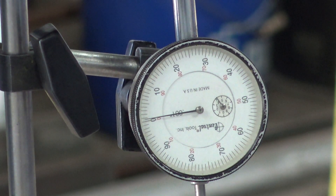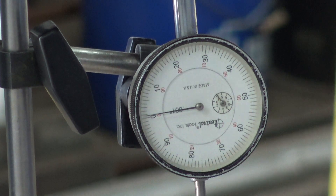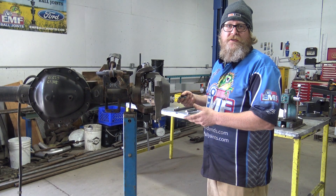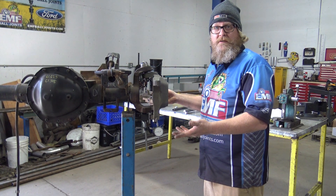It's tough to tell because it rotates, but probably about 8 to 10 thou of play — looks like 6 thou. I'm going to back the ring off and give it more play just so you can see what, for example, 20 to 40 thou of play looks like.